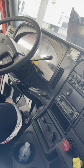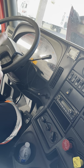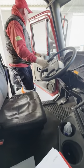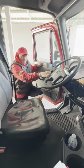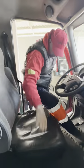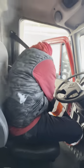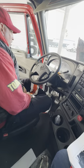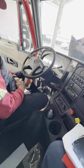At this time, I'm going to go outside and remove my chock and come back in to continue with my air brake test. I'm going to take off my seatbelt and open up my door. Three-point contact — one, two, three. I'm going to come back in using three-point contact: one, two, three, and lift myself up. I'm going to put my seatbelt back on and shut the door.